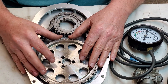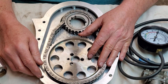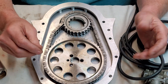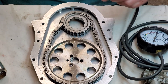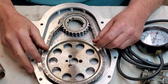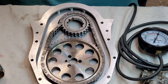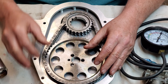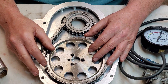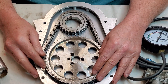You've got to think outside the box sometimes. I had one come in, set the timing on it, came back and the timing had moved. I thought — is the dampener slipping? It was a Ford, an older motor, and it had a valve stem seal that was sucking up oil. The distributor had a hollow pin in it — most of them did back then — and it had actually twisted the oil pump drive almost completely, and it finally broke the actual pin. If you didn't look carefully you'd never notice it because you couldn't see through the end of the hollow pin that held the gear onto the bottom of the distributor. Just crazy things you never see.